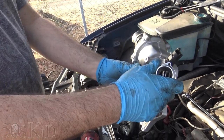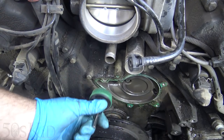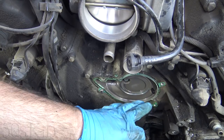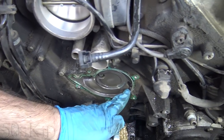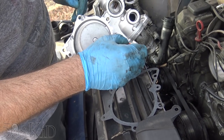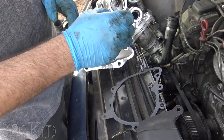This housing is all ready to go — be ready to put that thing on. We're going to need to clear this old gasket off of here, and it's going to help if we have a scraper, razor blade, or something. I brought a green roll-lock disc, which I'm probably not going to use. I brought a brass brush, which I probably am going to use. I'm not too worried about marring up the aluminum a little bit, because we've got a new gasket — gasket makes up for all that kind of stuff. But it looks like this one's kind of crusted on, so I'm going to do my best to get it off. We're not going to film that because it's just going to take forever. I like to put some dabs of RTV on here just to stick the gasket so it doesn't fall off. You don't need to run a bead because that's what the gasket's for — the gasket does the sealing. This is just a little bit of glue to make sure the gasket doesn't slip off.